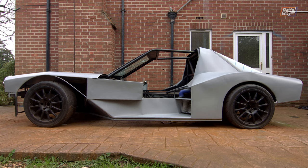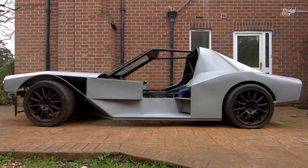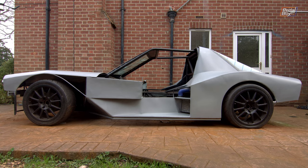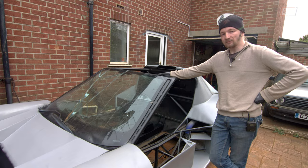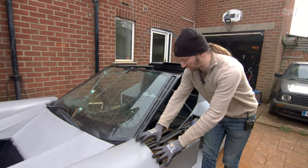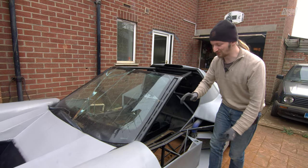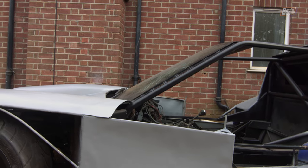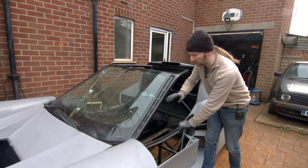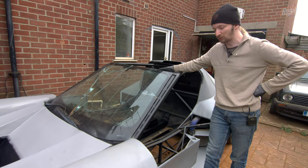Two years later, with the bodywork well underway, I'm still trying to decide whether to add some quarter lights to the A-pillars to deflect wind around the windscreen, rather than having anybody in the seats buffeted by wind wrapping around where you'd normally have wing mirror mounts. If we do add A-pillar windows, we'll follow a similar method to how we built the windscreen — finish the skin, find a window on eBay that looks about the right dimensions, then make up the frame to suit. And because we're inevitably going to get the frame wrong, we'll need to add plating material to take up the edges where mistakes go in.